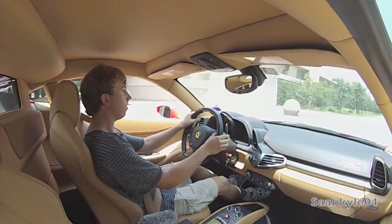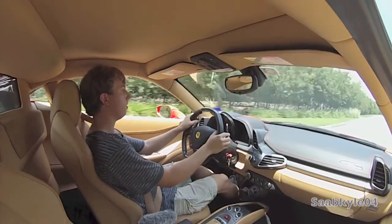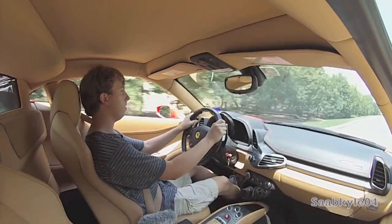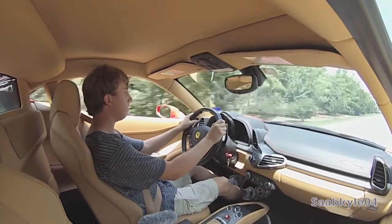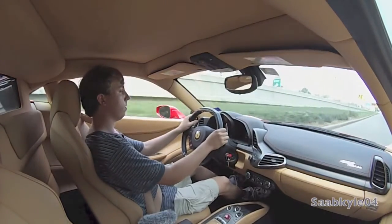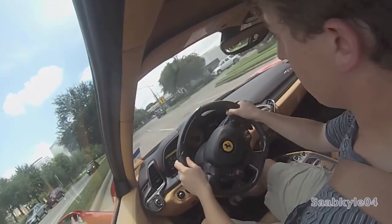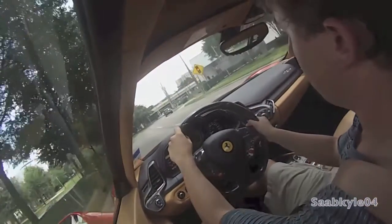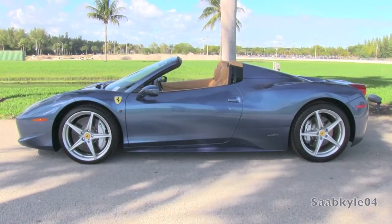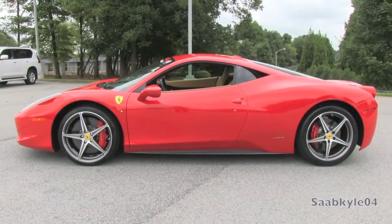This leads to improved torque distribution, or torque vectoring, out back, coming out of corners, which results in a 32% increase in longitudinal acceleration out of corners compared to the previous system, not to mention 28% less countersteering. The 458 has even set a lap of Ferrari's Fiorano test circuit in just 1 minute 25 seconds, which is about Enzo level.